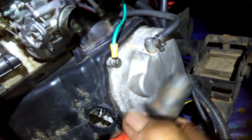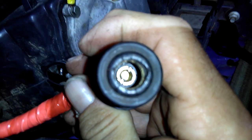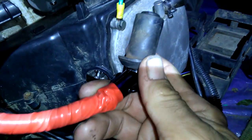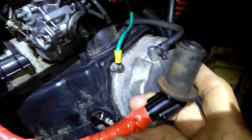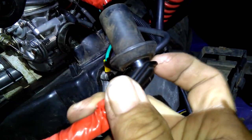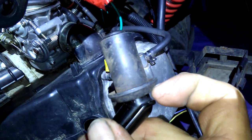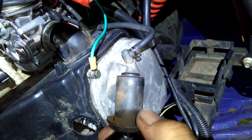And then I went to start it today after I put it all together. Went to start, and what I found out inside this boot here, pull this boot off. You can see how the plug has like a screw on it. So right in there, this screws into this here. It's plastic, and then there's like a screw that comes in here. You can screw the whole wire into it, and there's a screw that runs all the way through here, touches the backside of where the boot goes in. There's like a metal sleeve that goes down through here. And there's a wire, and it was touching the sleeve.